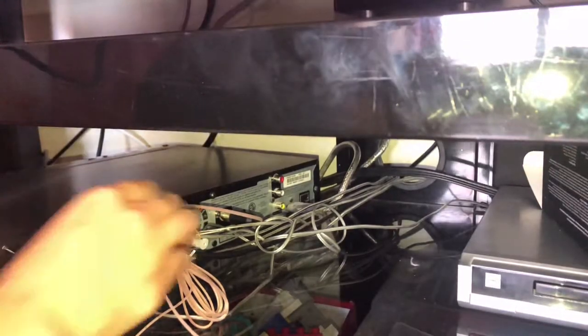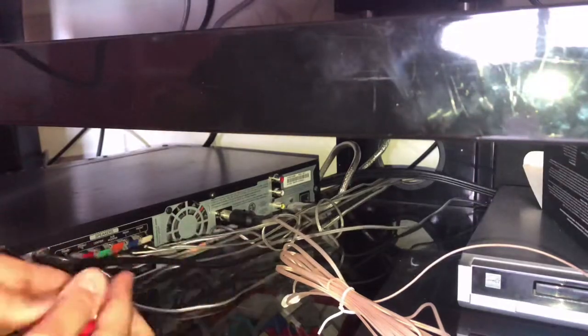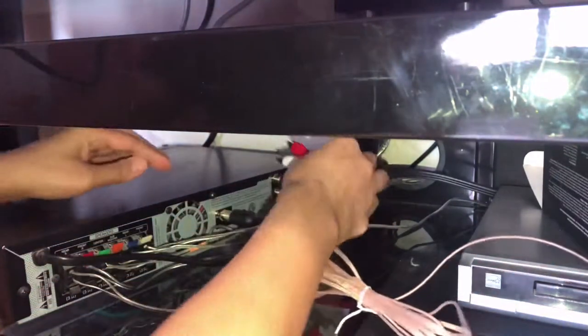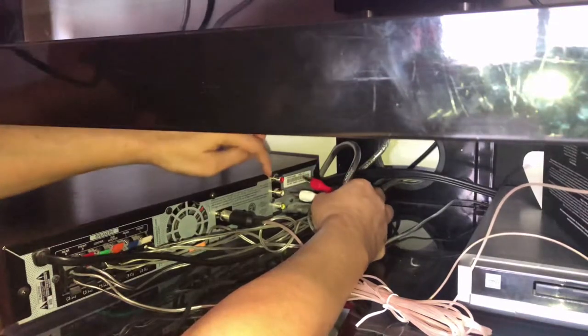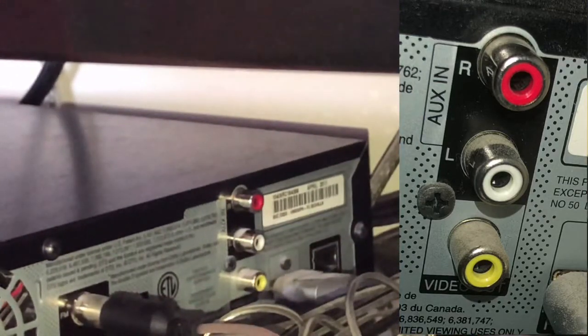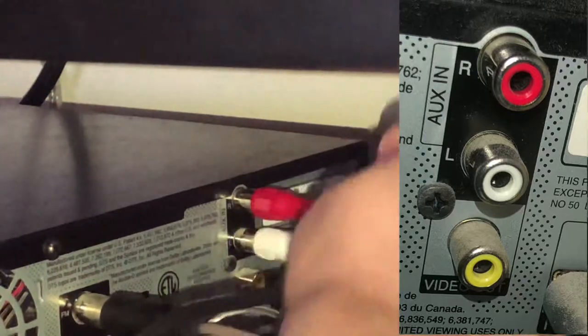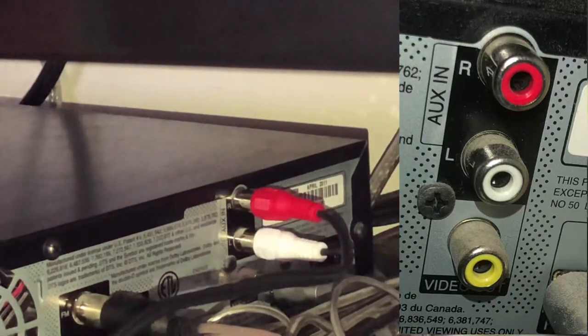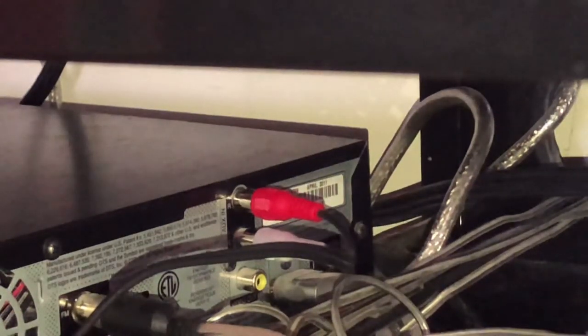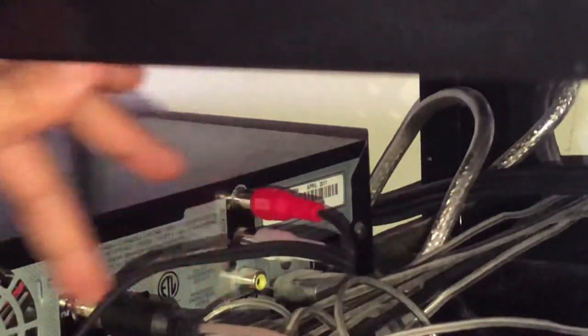As you can see, these wires are connected to the speakers. We're going to plug these two ends over here under 'AUX in' — white to white, red to red. The other end was connected from the sound card under 'earphone' or 'headphone,' so the sounds coming from the sound card will go inside here and come out from the speakers attached to this.